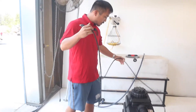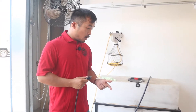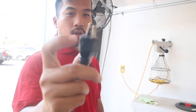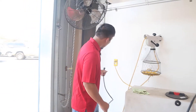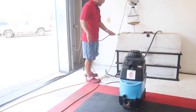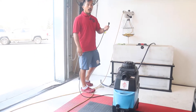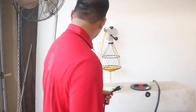The guys went out mobile and this extractor started smoking when they plugged it in, so I had to go out and swap another one for them. You can see this one is kind of burnt — it's also missing the ground, so that's fairly dangerous. I'm going to plug it in and see what they were talking about. There it is — that's one way to mess up an outlet.